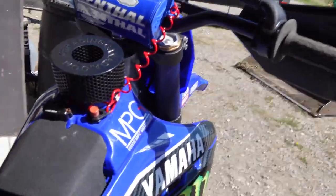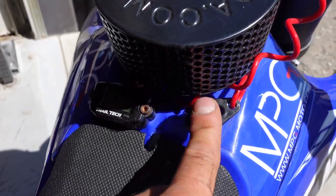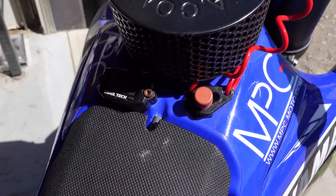I've been running the CR Racing intake for close to four years now. It's simple, it works — it's the best way to keep snow out of your intake. You just run it and forget about it. I also have my temperature gauge right there, along with my kill switch and intake. Underneath the airbox, stuck to the flat plate of the CR intake, I have an hour meter — especially useful since with the Vortex box you don't have the stock Yamaha connection.